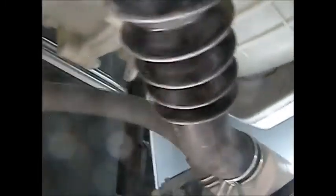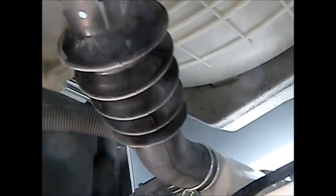You might be able to tip it on its back or take the back panel off. On some of the Whirlpools you can tip it on its back and get underneath. This hose has got to come off, that drain hose has got to come off, and there are some screws under here - two screws in the front.